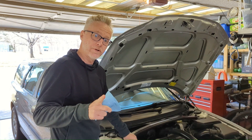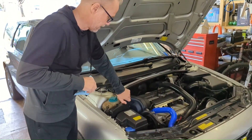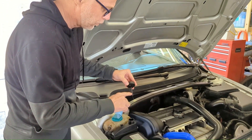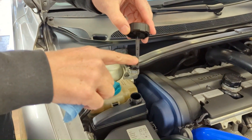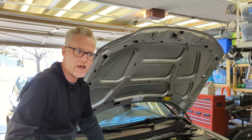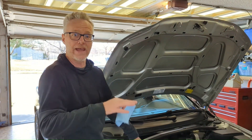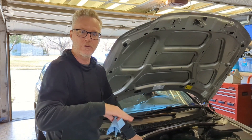When you're filling up your power steering fluid, be absolutely certain you do not go past the cold line on the little check dipstick. On the reservoir, you want to be at the cold line — there's an add line down below that comes in later. Fill it to cold, then go through your bleeding process: stop to stop, lower it down, hold at the stops, take it for a drive, come back when it's heated up, let it cool completely, give it a couple hours — I gave mine overnight — then check it. It will be below the cold line; bring it just back to cold and start the cycle over again.